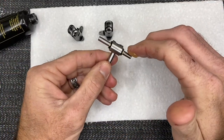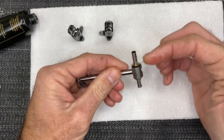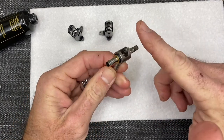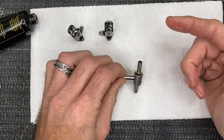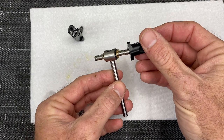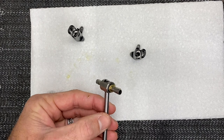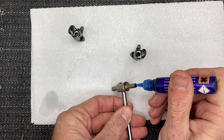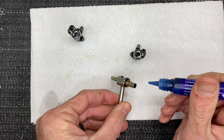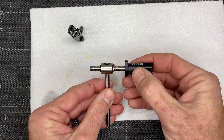Grease the shaft up on both sides, get a nice good coat of grease on here. Like I've said multiple times, I really like to get as much grease on a build as possible. Pick up your tail shaft, take your tail grips and slide them in. Before we slide this together, take a little bit of blue loctite — I just put a dab down there.